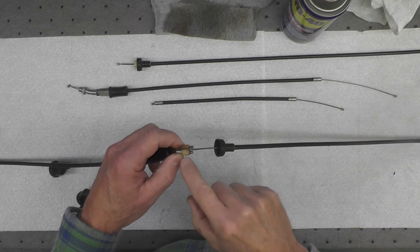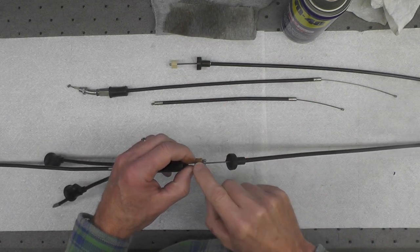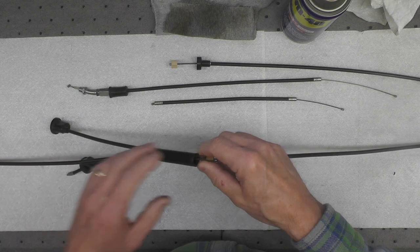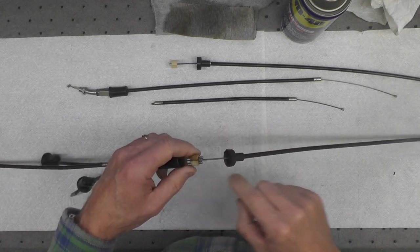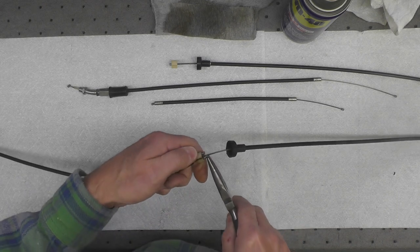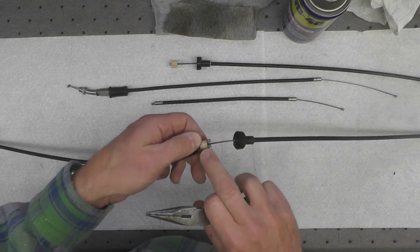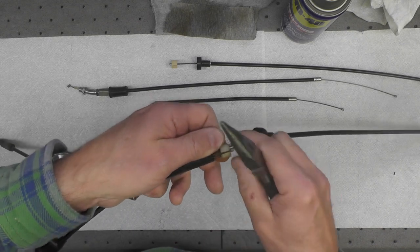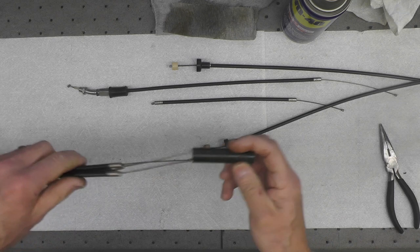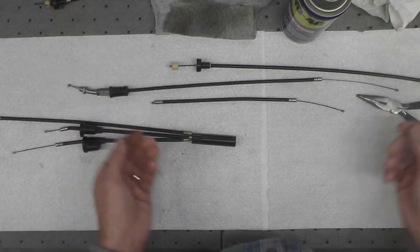Sometimes they can give you a little bit of a struggle. Since this white nylon block is also included on the new main throttle cable, it will stay with the old cable. But what I need to do is separate these three cables that go on to the rest of the harness from this white block, because remember one of these cables is going to be reused. Usually what you can do is just take a needle-nose pliers or a suitable tool and just pop them out — see that little slot right there. Now we have the main cable separated from the rest of the assembly; we will no longer need this.